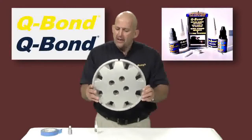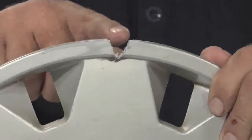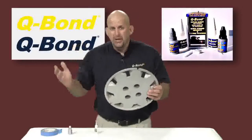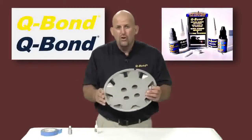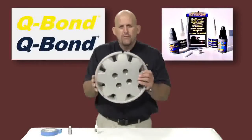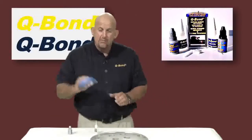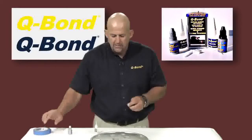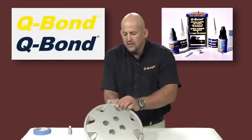Most of you have at one stage or the other driven up a curb and possibly taken a piece of plastic off like that. Now, how you can repair it, instead of just replacing all 4 caps, because you cannot just buy one at a time, I'm going to show you within 3 minutes from now how this item is going to be fully repaired. The first thing that we are going to do is use the same kind of masking tape. It doesn't have to be blue, it can be any kind of masking tape. And then we're going to stick it onto the rear of this cover.